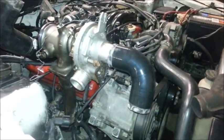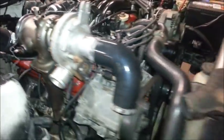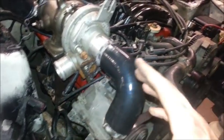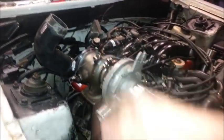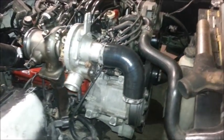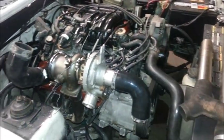I'm really still not sure how I want to do the intake. Do I want it plumbed in here so I can get more pressure right off the bat? Have the turbo right here, come down at an angle — basically like a mini intercooler. I'll get an intercooler later so I can run more boost and plumb it straight into the turbo. Could even put nitrous or methanol injection in here to cool the intake charge. I'll figure it out when I get more money — I've got all kinds of ideas.